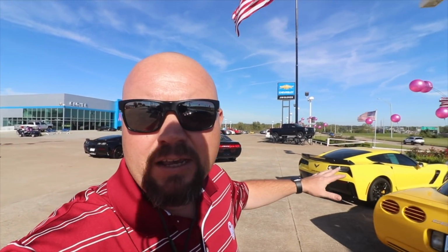But I'm here at Jim Glover Chevrolet, and you guys know that I lowered the car and went on a little play day, different things like that. And so what I am going to have them change, I had it aligned somewhere else, but I don't think they got the camber right. And you know, I just don't think it's toed right. I wanted it toed in just a little bit, if not at zero, versus I think it's toed out a little bit just by the way it's kind of pulling and some of the tire wear, things like that.